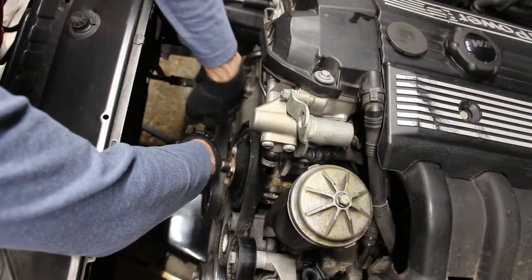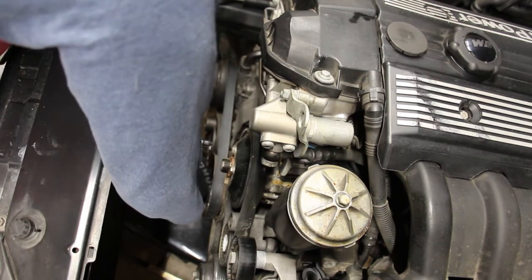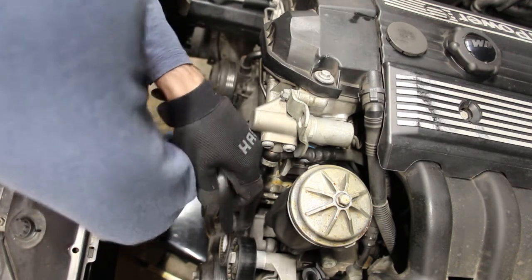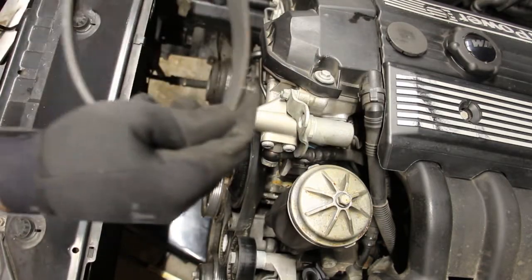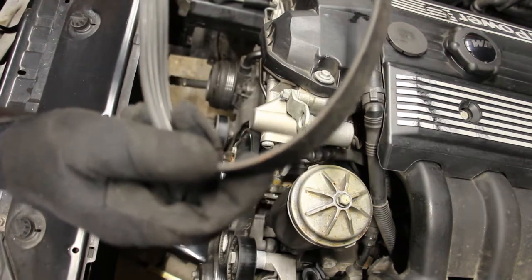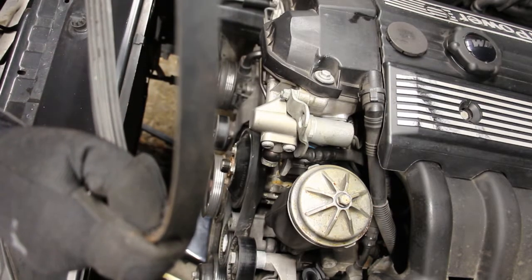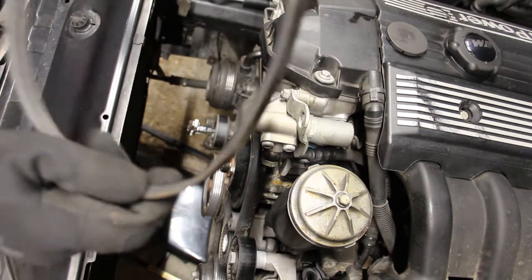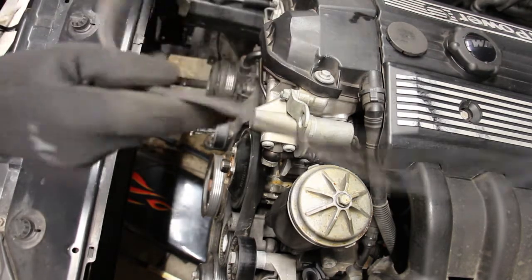And we're gonna turn clockwise here. It's fully inserted. Push down, yeah, see, tension is off. The belt is removed. Inspect it for cracks. Actually, it looks like this belt may have been replaced not too long ago, because it looks almost new, so we're gonna keep this.